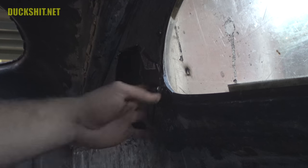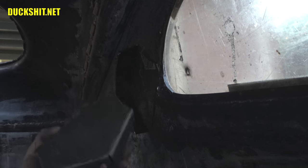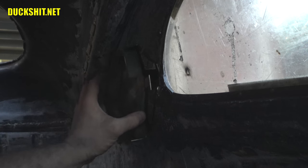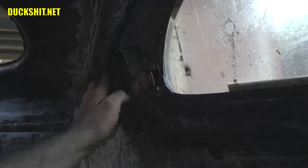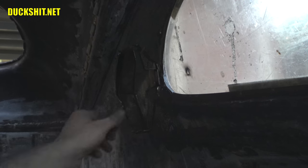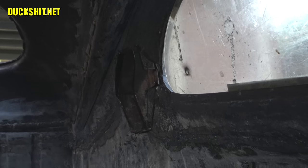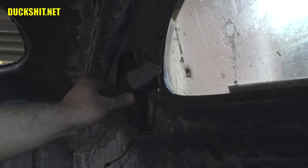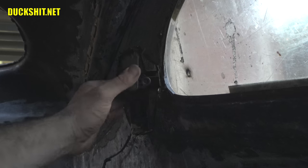Up in this hole here — I made a box that'll fit right into it, and it just happens to be green. You might recognize this color as the color that Eleanor originally came in, because this was a piece of the roof that didn't get used. It fits in the hole. I don't know how far I'm going to push it into the C-pillar, but that gives you a pretty accurate look at what we've got. The motor should sit in there nice and recessed, with just the arm sticking out at the diagonal to push the window open.